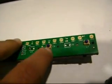The only 2 points, we'll solder the first point, the first pin right here, and the last thing we're going to solder on the board is the negative. Now, before we solder the negative, we're going to go ahead and put in a resistor to limit the current on the LEDs that we're going to put here. Now, you're probably asking how we're going to place the LEDs if we're going to knock out these sockets.